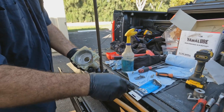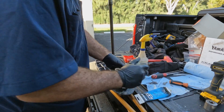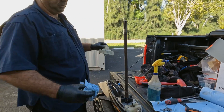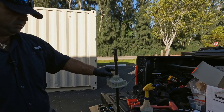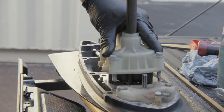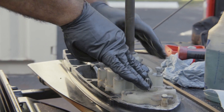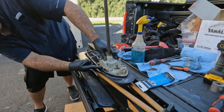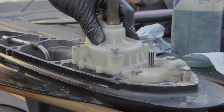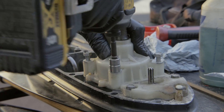Grease all the bolts, and always turn the shaft clockwise when you're putting the water pump housing on. Let it sit right there, grab the drive shaft and push down, turn it very slowly, and it pops right back into place. If you're not 100% sure that the o-ring didn't pop out, you can always look and visually see it from the sides — make sure it's completely even and sitting flat on the plate. If you see a little space, don't take your bolts and screw them down because you'll cut that o-ring if it popped out.